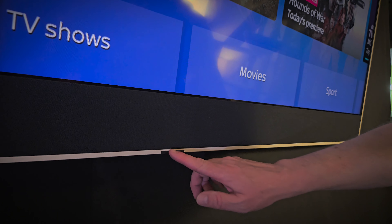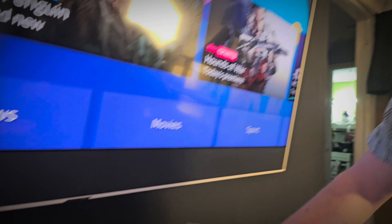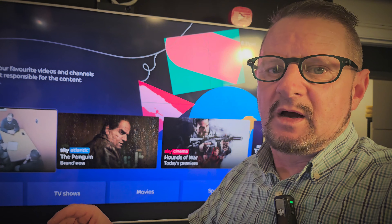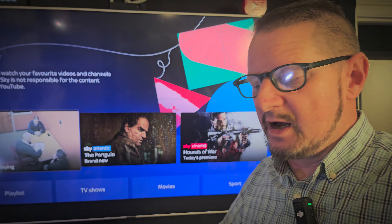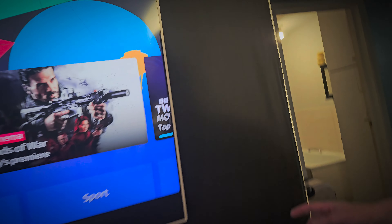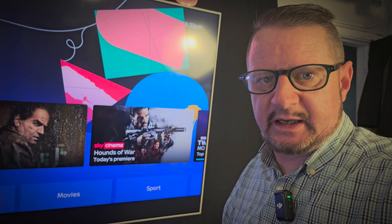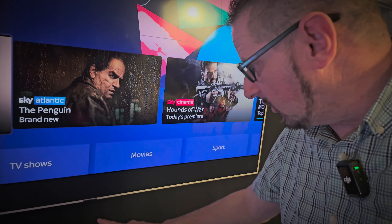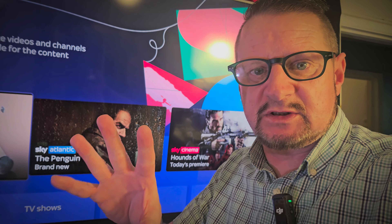You'll be greeted with no light at all or a slowly flashing red light. What you need to do, like I said, I unplugged mine — it says you don't need to, but it was just easier for me from the actual plug. Then around the side of the TV, or the button is just down on the bottom of the TV, hold that button, plug your TV back in, and keep that button held until the little light starts flashing — not just a slow pulsing, but really, really flashing. Then let go.